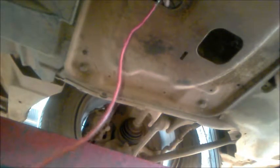I'm going to the middle wire now. That should either be battery voltage or ground. I see zero frequency on it. Okay. If I switch the multimeter to voltage, it shows very near zero voltage. I'm switching it to resistance and I'm seeing 7.6 ohms. Hope you can see it there. Very tricky shot this is. So that means that is a ground and it's good. So now I should get battery voltage on the last wire.